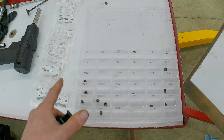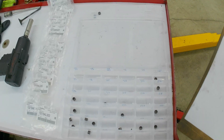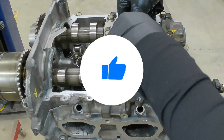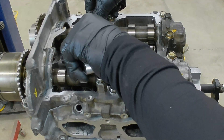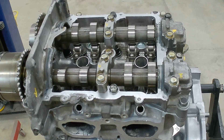I made an organizer and ordered a few shims — obviously not close to a full set, but I feel like I have enough to get where I need to get. That's pretty much the gist of how to do the valve adjustment on these. It's a lot of work — it's not the easiest in the world, but this is what Subaru has given us. After some finagling around we've been able to get all the valves on both sides adjusted within the proper specification. In the case of almost every single valve we did have to change out the pucks a couple of times to get it into the right specification. So it's really important that you have yourself a good assortment, or you're going to be ordering parts and waiting. That collection of valve pucks took about a week for all of them to come in when I ordered them, so keep that in mind when you're starting this job.